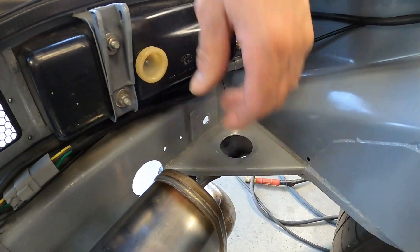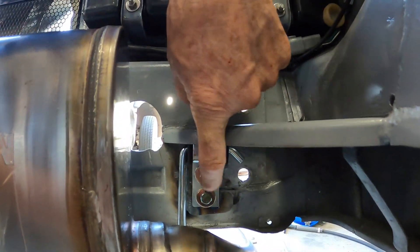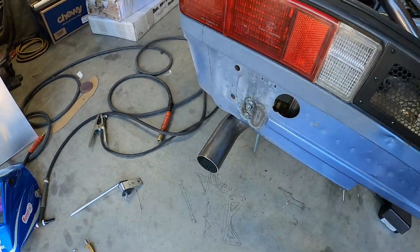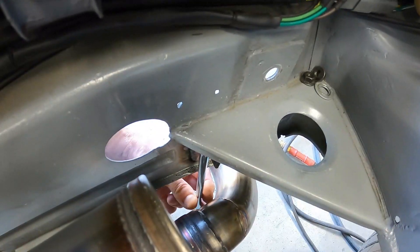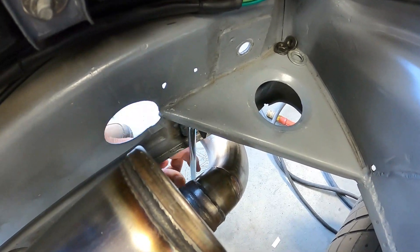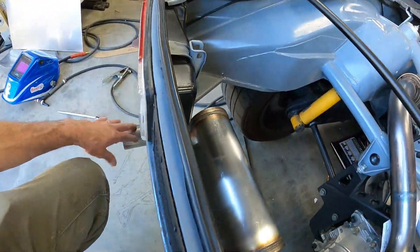So I decided I didn't want to do that, and after playing around, this works out great. I'm partway through making a little doubler plate just to give it some more strength — it's not going to take much of a load, but just sheet metal. That bolts through the chassis to a couple of nuts I just welded on the outside. This is under the bumper, so those fasteners come out and this comes off. Also, I'm not going to weld this to the exhaust tip. I want to come up with a tab and another fastener. I'd kind of like to be able to undo a fastener, off comes the V-band, and the muffler can come off, rather than having to take all this apart and fit it back together.